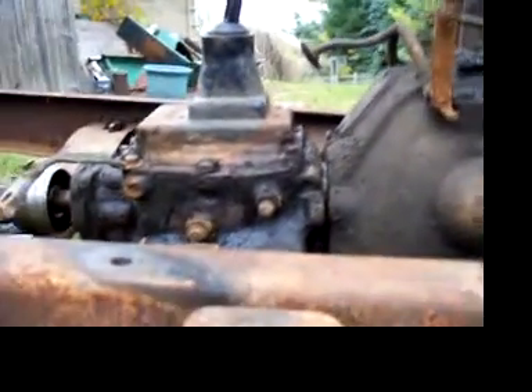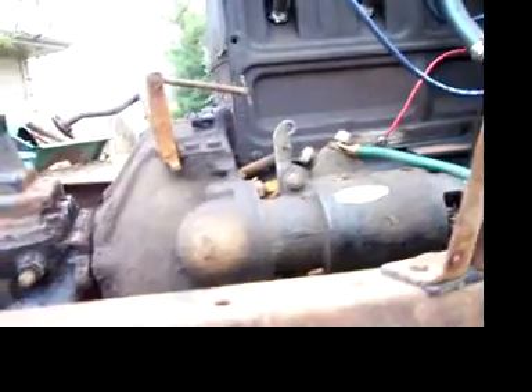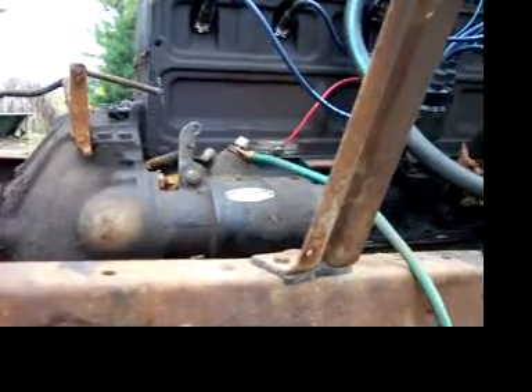There's a cover that comes here, and then there's two bolts underneath, straight back in here — just two bolts on the bottom. For any of you guys watching: to drop the transmission, I don't know any easier way than moving back the rear axle or taking off the engine. If you're planning on taking off the engine, that's your best shot. But I'm thinking I'm going to leave the engine on — I'll take the transmission off and maybe play around with the engine this winter.